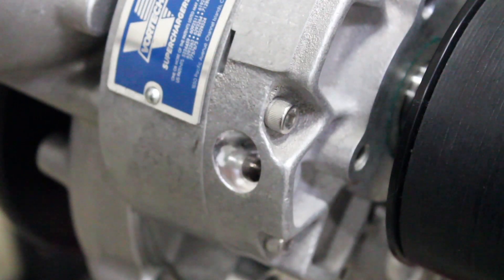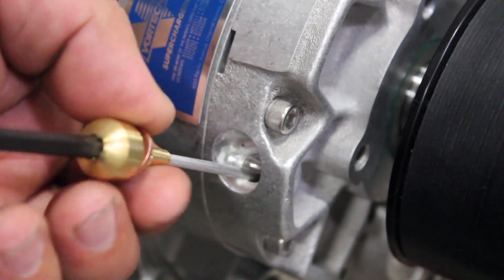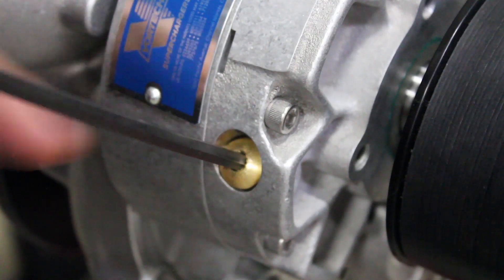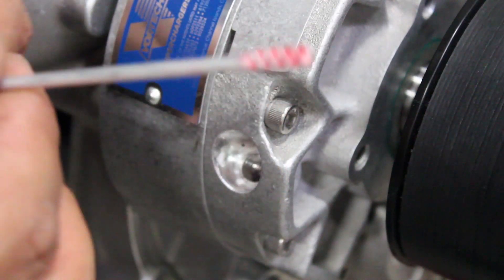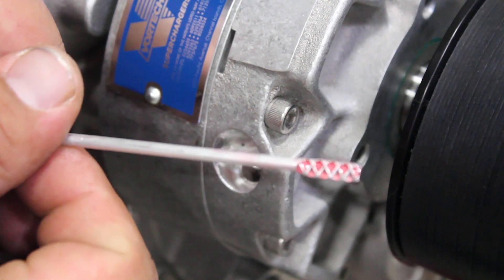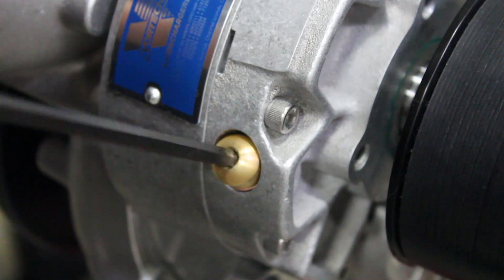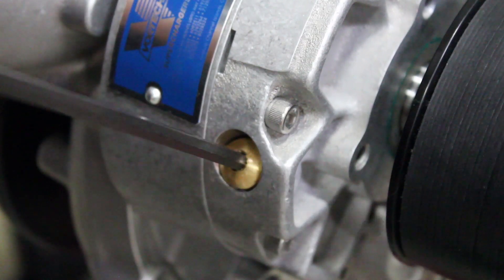Now that you have the oil in the Supercharger, check the oil like you would on a car. Put the dipstick back in, making sure that the crush washer is in place. Get the dipstick threaded in and let it bottom out, but you don't have to tighten it all the way since we're just checking the fluid level. Remove the dipstick — you should see some oil registered on the hash marks, which tells you there's plenty of oil in the Supercharger. Just to be safe, fire up your car for about five minutes and let it idle to make sure all the oil works its way into the bearings, then go ahead and check again. As long as you're still on the hash marks, you should be good to go.